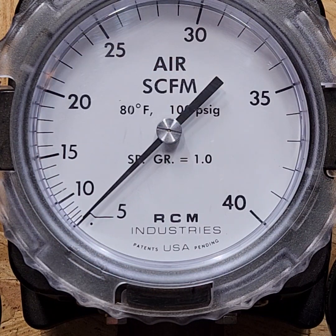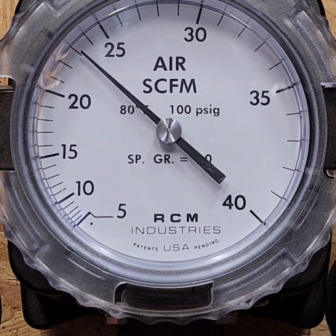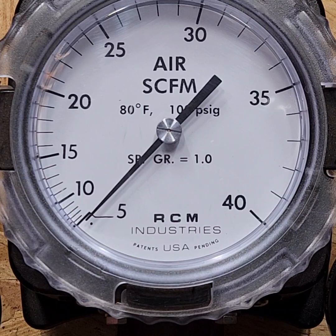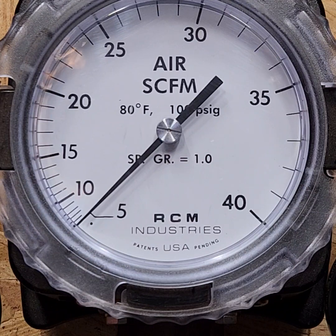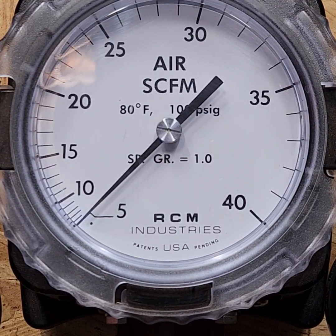Now we'll look at right angle, a very conventional, very common right angle die grinder. 23-ish CFM, and that die grinder is rated on the box at 4 CFM. So here's a straight die grinder, also rated at 4 CFM. So that's up around 27 CFM.